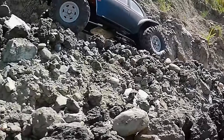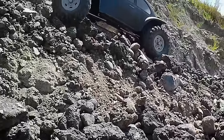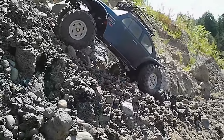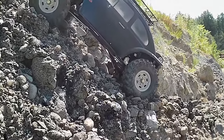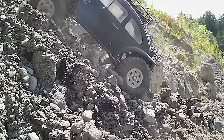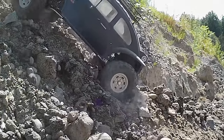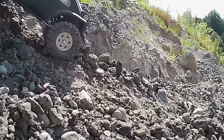Look at that fancy skid plate. That right there is a homemade piece of metal stuck on with shoe goo — I think it came from some stud work. I'm an electrician, so I pick up random stuff from job sites that might be useful someday. I had this piece sitting around, grabbed tin snips, trimmed it to length, and slapped it on with shoe goo. Now instead of just a flat plastic skid plate, it's got a piece of metal covering more where the motor is exposed and extending further back to where the drive shaft is.